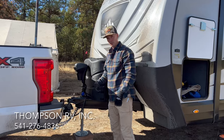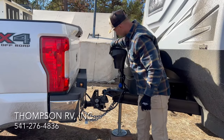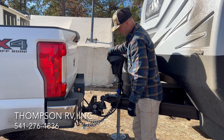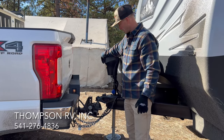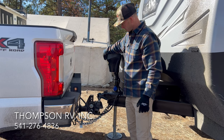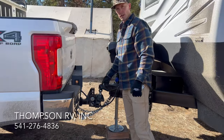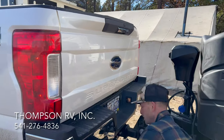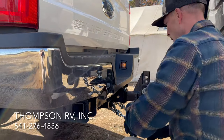Now that we've got the weight off of those bars and those out of the way, this coupling isn't going to want to unlock because we're pulling up on that ball right now. So I'm going to retract this jack down just a little bit to take the pressure off of the coupling. Now that that's put a little more weight back on the truck, we can open it up and come up off the pickup. Now I'm going to unplug that seven-way cord, disconnect our break-away cable, and remove our chains.